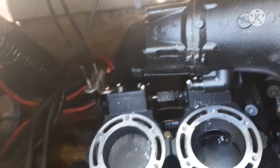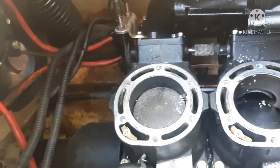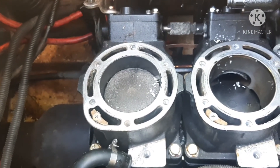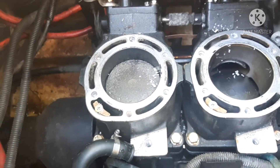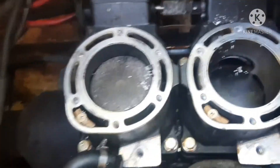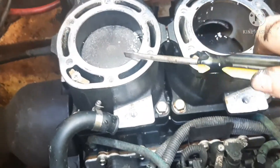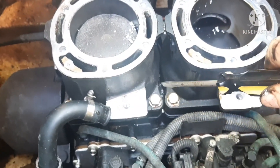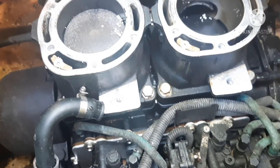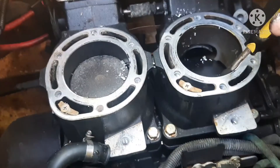But you don't go to 27 immediately. When you re-torque this thing, you go about half — like 11 foot-pounds to all the bolts first, then you go and torque it on down to your final spec. That's the procedure. One thing I like about this Yamaha over the Kawasaki is each cylinder is individual — I could just do one cylinder, pull that off, boom, replace that, boom. But I'm going to do both because I like being thorough and I like doing the job right.